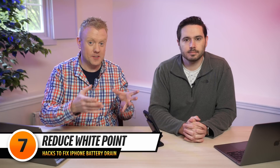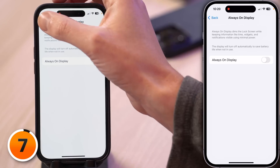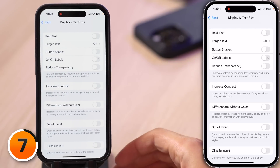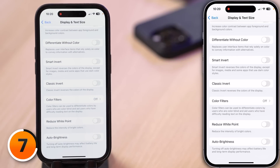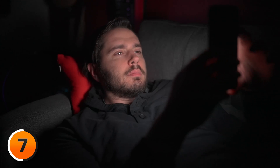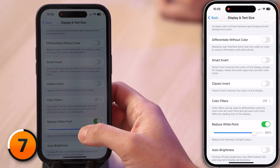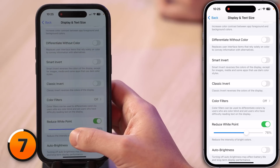Our next setting is a display setting that doesn't live in the Display section. Tap back to the main page of Settings, tap Accessibility, then tap Display and Text Size, and scroll all the way down to Reduce White Point. Think of this setting as recalibrating the brightness slider on your iPhone — you can still adjust your phone's brightness, but each setting is just a little dimmer than before. It also makes for a more pleasurable experience when you need the display darker than the brightness slider allows. Tap the switch next to Reduce White Point and set your preferred intensity — the further right you drag the slider, the darker your display becomes. Apple recommends leaving Auto Brightness on to increase battery life, as people run into trouble when their iPhone is at high brightness all day long.